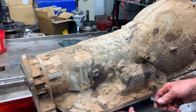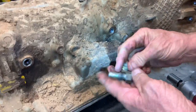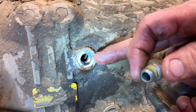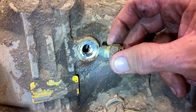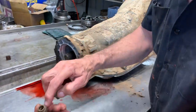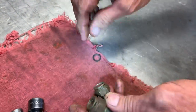You notice you have a short and a long cooler tube. This long one reaches inside and goes into the center support into a seal down in here. If you put the short one in there, the fluid just falls to the pan and burns up all your drop chain. Your kit will come with new clips and new O-rings — you can clean these up and reuse them, just put new seals and new clips in here.